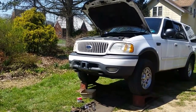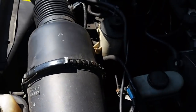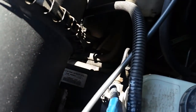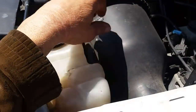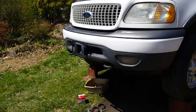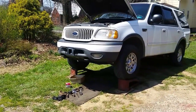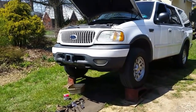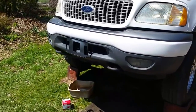First thing is you've got all this stuff up here — you got the air cleaner hoses, you got a steering column down there. Even if you take all this out it is literally impossible to get in there to get that oil filter out. If you're gonna do this, save yourself a lot of time and hassle — simply put your vehicle up on the ramp like I did, put some blocks behind the wheel, and you're gonna have to go underneath.